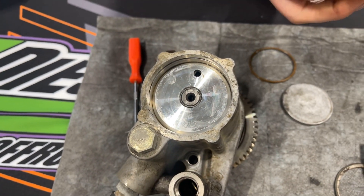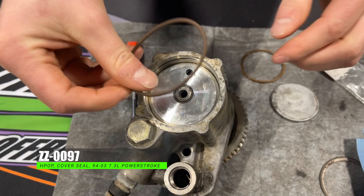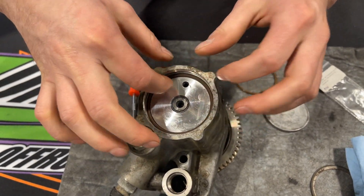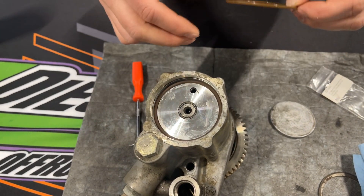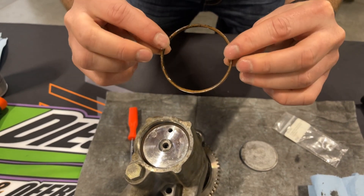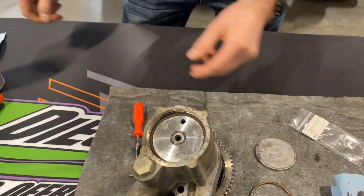You're going to take our ZZ-0097 O-ring and place it into your original groove. You can see that it fits a lot different than the old one here. This old one, from sitting there so long, is actually square — probably the reason it wasn't sealing up anymore.